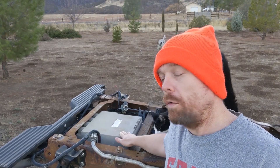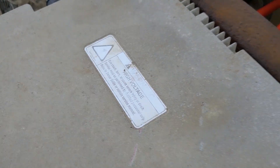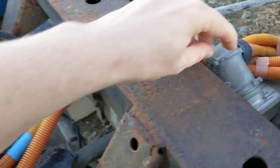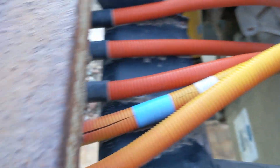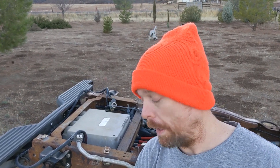If you're familiar with EVs, this is something that's called a motor controller. Essentially what it does is it takes power from the battery and converts it into usable energy for the motor. You have these two DC power input leads coming from the battery — there's a coupler right here that leads to the battery. From there, there are three AC power leads that go out into the main traction motor. Essentially what this does is it tells the motor how much power to apply to the wheels.